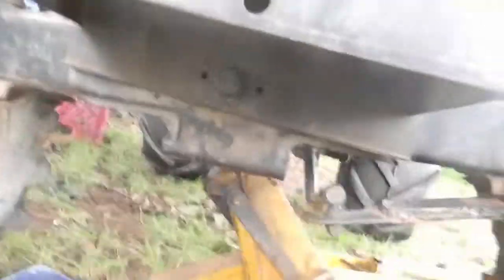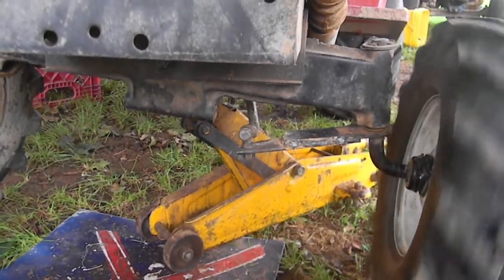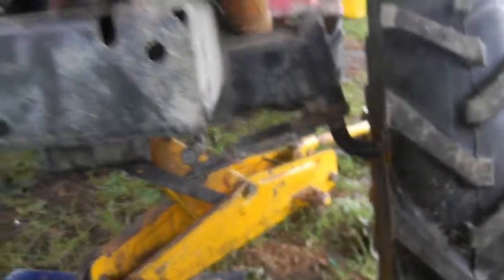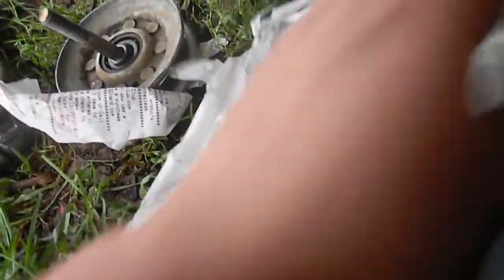I haven't bolted the front axle on yet. I shoved the washer up there and got the bolt really tight and now the axle is really stiff — it doesn't automatically articulate. I'll probably have no noticeable performance difference. One more thing I want to do today — I'm putting my old pulley back on using the same bolt with a new nut and a ton of washers, and I'm using a lock nut this time. Did not have a lock nut before — now we have a lock nut instead of a regular nut and a lock washer. Idler reinstalled.